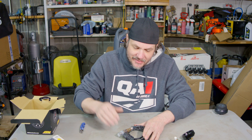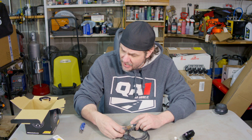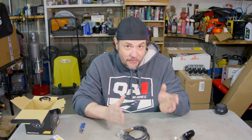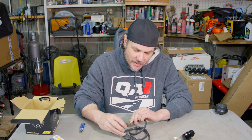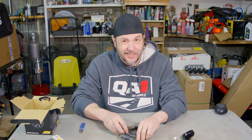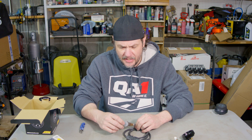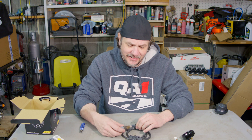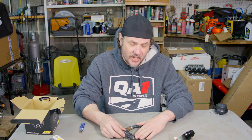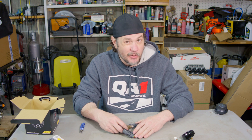I would think that anything you buy in 2024 should have a Bosch sensor. Hit up the comments — if you bought an AEM gauge recently, from when this video is posted onward, and you got any sensor besides a Bosch wideband sensor, let me know. Same goes for any Holley EFI system. If you recently purchased a Holley EFI system, let me know if it comes with the Bosch. If you bought a Holley EFI like a Terminator or something last year, I wouldn't expect it to come with it. I think Holley did what they always have done and bought a contract for a bunch of cheap wideband sensors, and that's what you get.